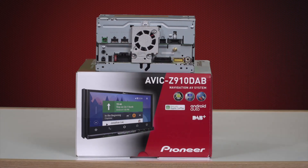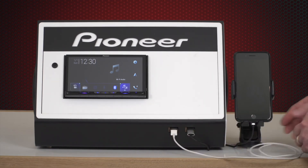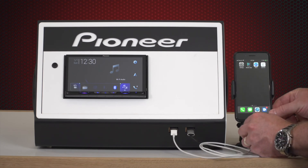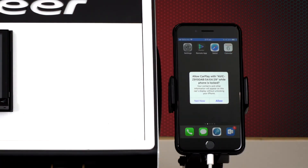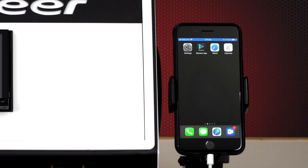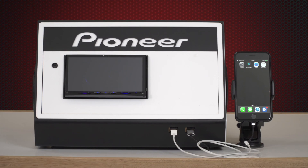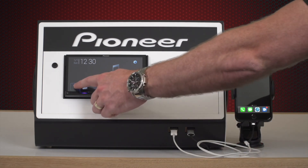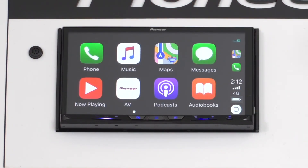Run this extension to a safe place in the cabin and connect your compatible USB to lightning lead. Connect the lightning connector to your iPhone and you will see a message prompt on the phone asking if you wish to allow Apple CarPlay while the phone is locked. Select Allow. Another prompt will appear on your iPhone asking if you wish to use wireless CarPlay. Select Enable Wireless CarPlay. Next, unplug the lightning lead from the iPhone and the Apple CarPlay display will disappear from the Pioneer receiver. Go to the home screen of the Pioneer receiver, select the smartphone icon in the bottom corner of the screen, select your phone from the list, and Apple CarPlay will connect wirelessly.